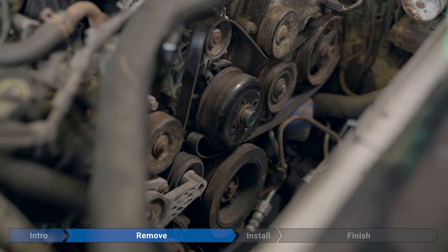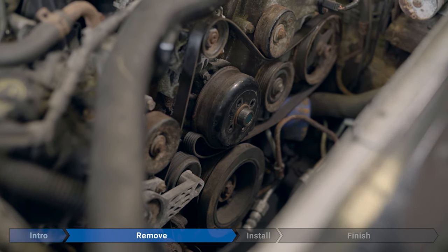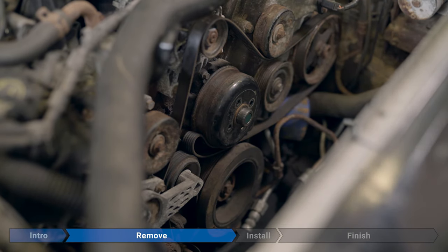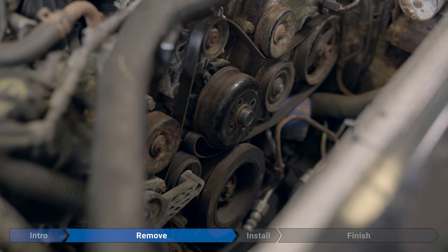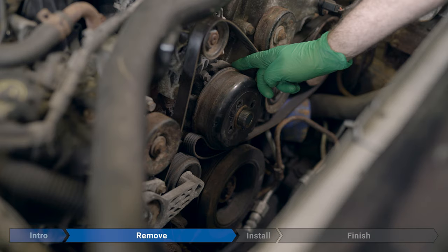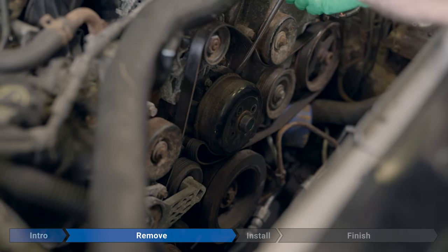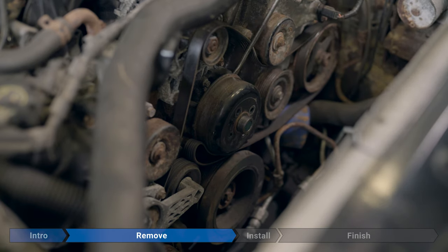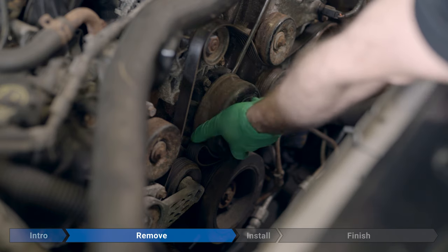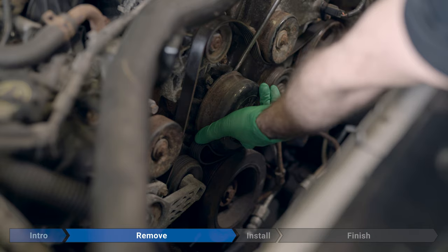There are a couple of different ways to get the pulley off the water pump — it might be seized on or rusted in place. If you've got a gear puller, grab onto the edges, push in the center and pull it out. We're just going to use a screwdriver or pry bar. There's a bolt on the driver's side holding the water pump in place. Wedge something between that and the pulley, pry back a little bit, rotate a little, pry, rotate, pry — keep going and it'll move a little bit each time, and eventually it should just pop right off.